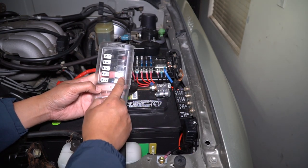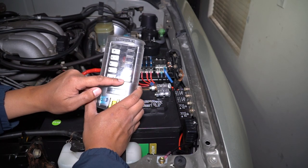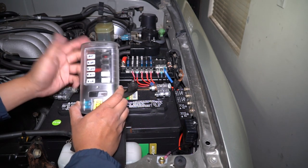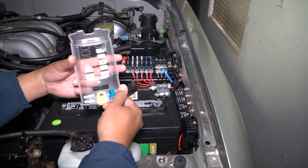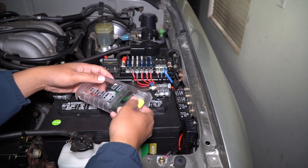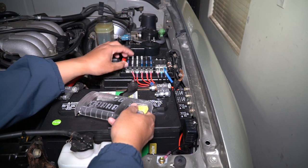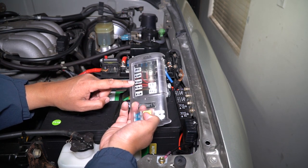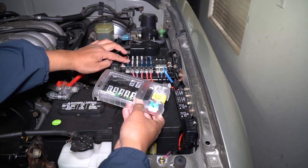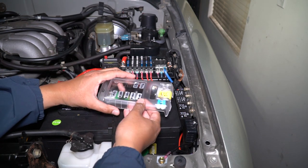CB radio I have it directly wired. So if you don't need a relay to run your components — like a CB radio or the fridge I have in the back — you can just run it directly to the fuse block and fuse it appropriately. Inside the Blue Sea it actually takes a couple of spare fuses. Most of my fuses are 15 amps, and the rear LED and bumper LED use 25 amps. I use all the empty slots for extra fuses just in case. I've never blown a fuse on this, fortunately, so I've never had to use them.